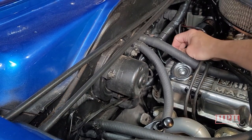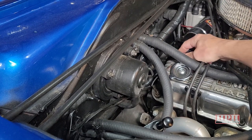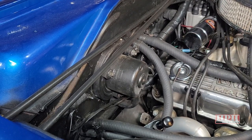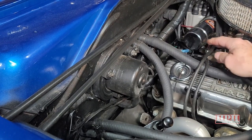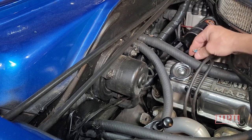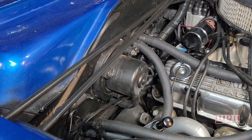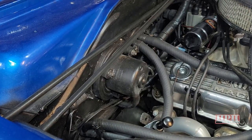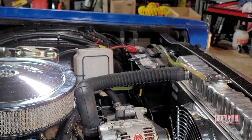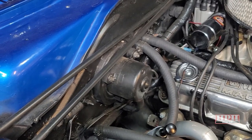Now with this car, it just comes out on a green wire. You'll have a green and a black. The black goes to the chassis ground right there. The green one will be your power wire going into your wiring harness. If you have the Chrysler C-Body style, which is a mid-60s Dodge Chrysler Plymouth, yours might be the same. Usually your fan probably only has two wires, so find the one that's not attached to the chassis ground — that'll likely be your power wire. Then we'll take our little test wire and connect one end to the positive on the battery, and the other end to the fan. If the fan works, it should kick on.